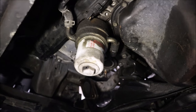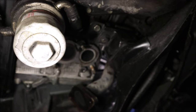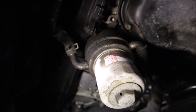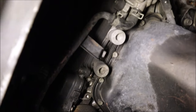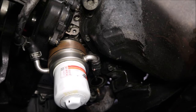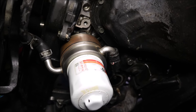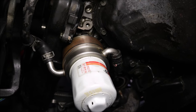Would you look at the condition of that oil cooler — you can't even see that it's supposed to be a copper color. I do have the O-rings for it, but I don't want to drop it because you lose about a gallon of coolant when you do that. I might just try to loosen the bolt and slide in a new O-ring, and at least clean this up until I can drain the coolant and do it completely properly. This front timing cover is probably going to have to come off anyway because it looks like it's leaking from a few other spots. I learned to just start cleaning before I do the repair, because dirty, gritty, nasty, sandy oil is not the best help when solving oil problems with new O-rings — so clean it up first.